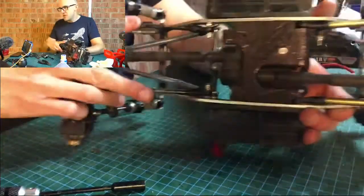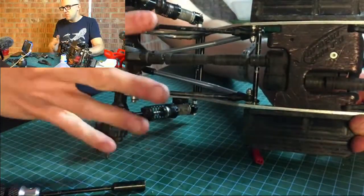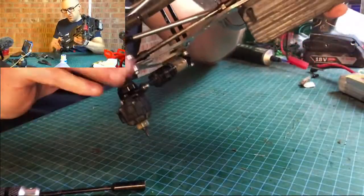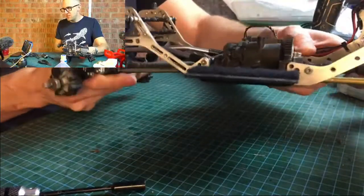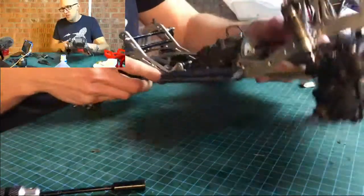And I have set my rear links to be quite square. It changes the position of the roll centre. It does affect articulation a tiny bit, but yeah, it's actually plenty. By the time you've got a wheel on there exaggerating the effect, there's more than enough there. I'm not a huge flex person, don't like flex, but you know, we'll see.